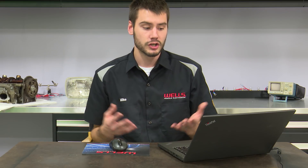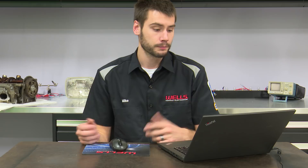Right away you think maybe the vent is stuck open or the gas cap is off — that's what this tech thought. But what if the computer opens up the purge solenoid and it never physically opens? There's no position sensor on older cars, no strategy to watch fuel trims or oxygen sensors to verify that purge actually opened. Older cars just trusted that when the computer said open, it did its job — not always the case. If that front door was stuck closed, the fuel tank pressure sensor never responds, the computer thinks there's a large leak, and it sets a large leak code — not a purge code. The technician missed the purge solenoid.